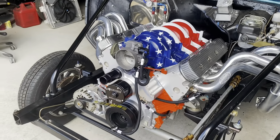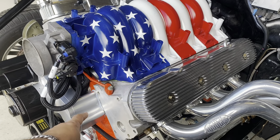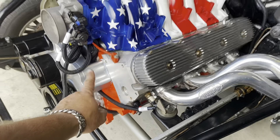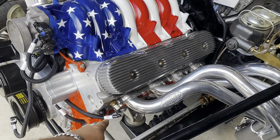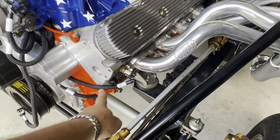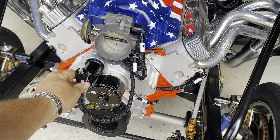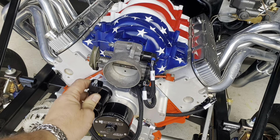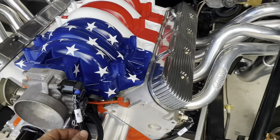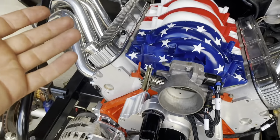I just love that intake. So we got the wiring harness routed under the intake manifold — these two come out and plug in there. Coolant temp comes out the front and goes under the water pump. Had this not had a common ground with the rest of the harness, and I didn't want to void my warranty by cutting it, I'd have added a ground to it and run it down the bottom side where the cam sensor comes from. IAT sensor is going to be under the elbow right here, but I've got to get the right size bung — that'll matter later on. These two reach. There's a fuel pressure sensor but I'm just going to zip tie it because I don't need it right now.